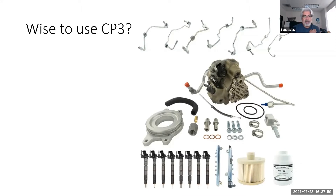I called one of my guys over at Bosch and asked: I remember when we were playing with the CP3 pump on a test stand, and the CP3 doesn't do well above 25,000 PSI. Yet the CP4 can hit 29,000 and now it's hitting 36,000. So how are these guys getting away with putting a CP3 in a 6.7? The computer is demanding pressure, so they're playing with the duty cycle on the volume control valve — the MPROP, as we called it on the CP3 pump.